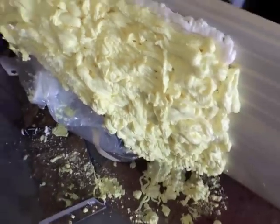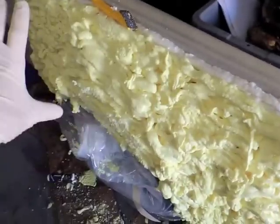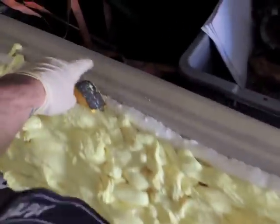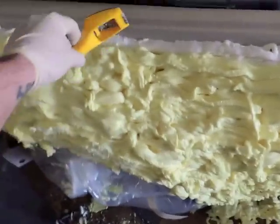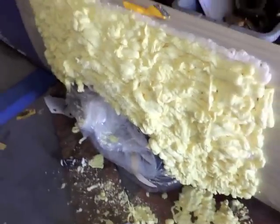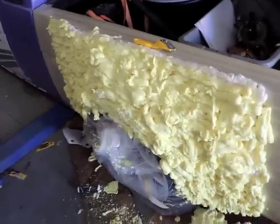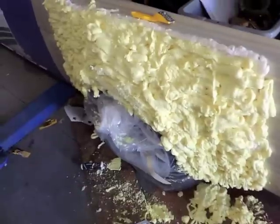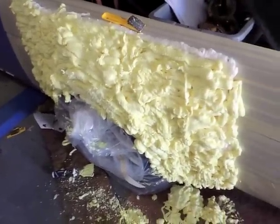It looks kind of like a dually flare - it's kind of weird. Anyway, I started with masking everything off and then laying expanding foam over that. I'm going to shape it with rasps, then coat it with drywall putty since it's super easy to sand and a lot cheaper than body filler. Once I have it pretty close with the drywall putty, I'll go over it with body filler. For now, enjoy a montage.